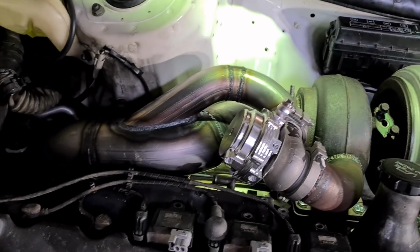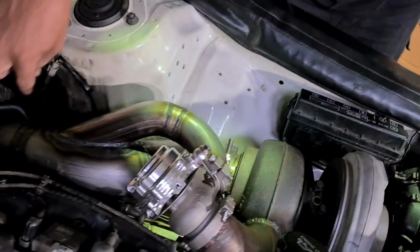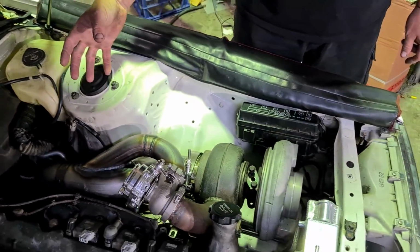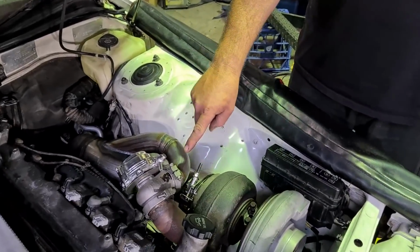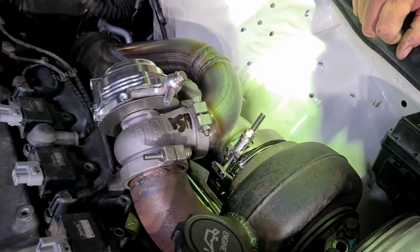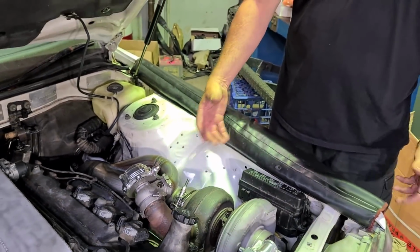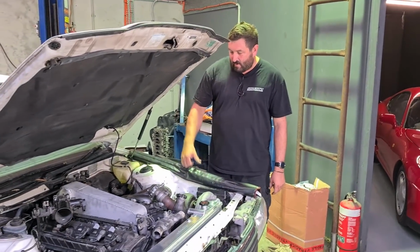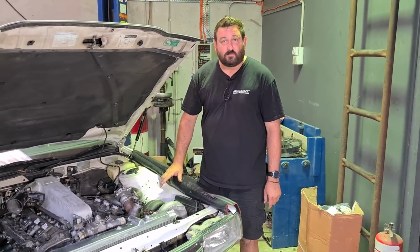It worked out alright. Actually, I managed to get the wastegate pipe in at a decent angle. Got clearance in the chassis rail, got clearance on the manifold, and I turned the last piece around into a 3-bolt flange. So it all still goes in there in one piece. And by some miracle, that's still totally flat. I actually took this off and completed it on the bench, all bolted up tight. Alright, so now we'll get the car up and I'll start heading backwards from there.